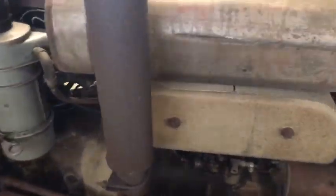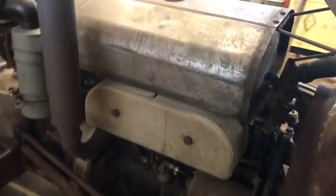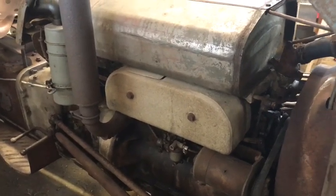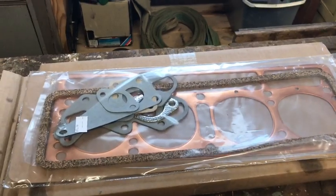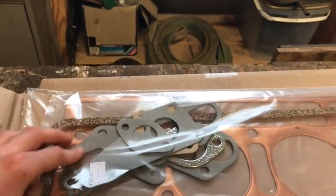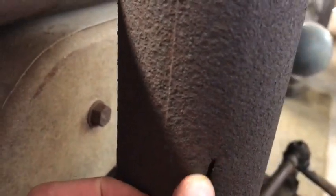I've also drained and flushed out the oil, although there's a little bit of fresh oil in it now because I put some back in before the compression test. I've also taken off the air hose for the carburettor that runs up to the air cleaner. Here on the bench is the cardboard to lay everything out, and this is the gasket set: copper head gasket, manifold gasket, rocker cover gasket, and carburettor and thermostat gaskets. I think I'll also need to repair or replace the exhaust pipe because there's a small hole, but I'll cross that bridge when I get to it.